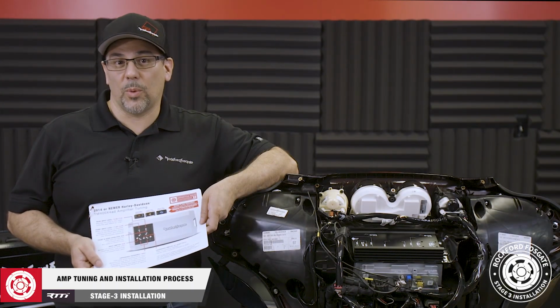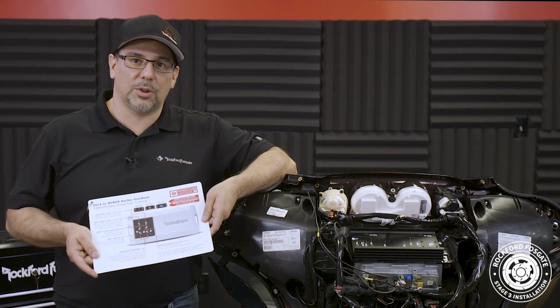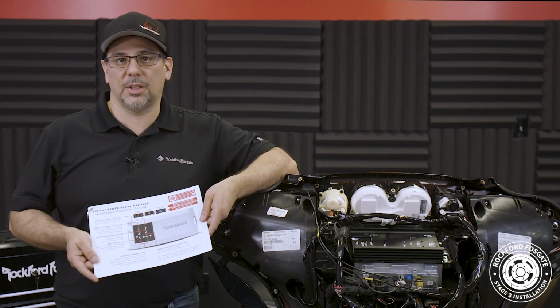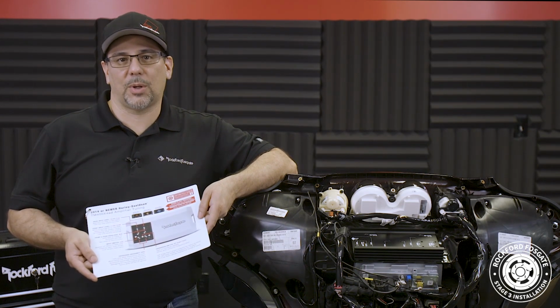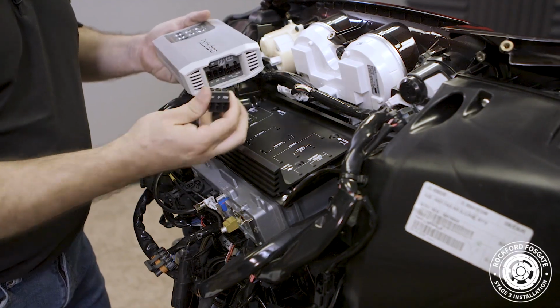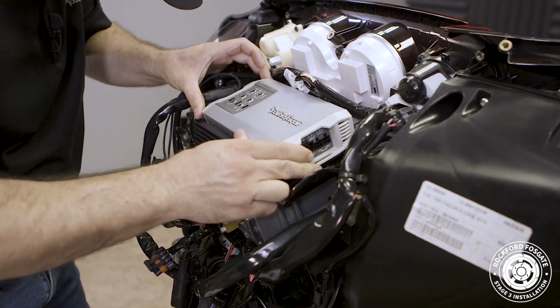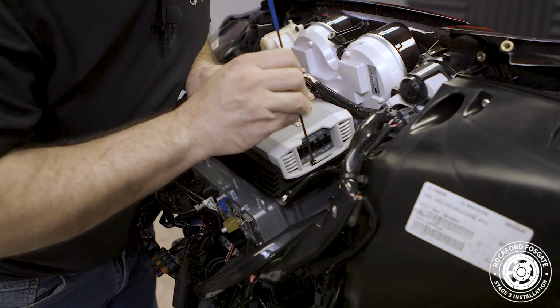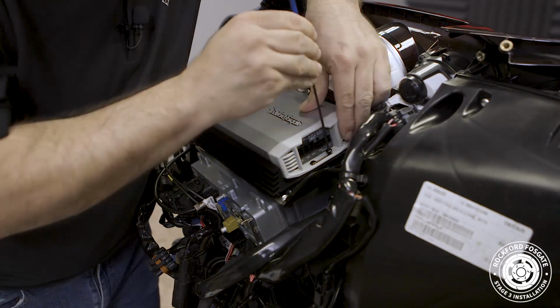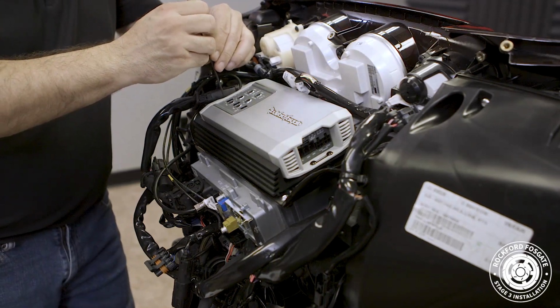Now that we're done with that, we're ready to tune our amplifier and install it. Now we offer this free amp tuning guide that's available in the description of this video and through this kit's product details page at rockfordfosgate.com. Once we get the amplifier configured, we'll secure it to the amp bracket using the supplied hardware and a 2.5mm Allen driver. Before proceeding, be sure to remove the pre-installed power connector in the amp since our harness already has one.